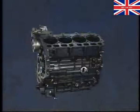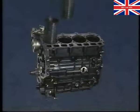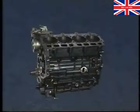The cylinder block is cast iron for maximum strength, and the crankshaft is housed in a special tunnel machined directly into the block. A one-piece alloy bearing carrier houses the rear main bearing, and there are 3 more two-piece carriers inside. Like the K-series engine, the 825 diesel uses wet cylinder liners, where coolant is circulated around each liner for maximum cooling effect. The pistons have specially coated crowns to help them withstand the immense pressures and temperatures.